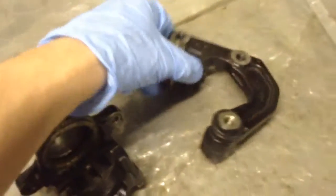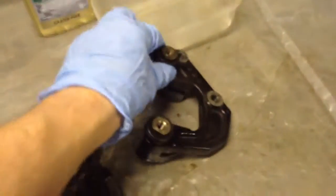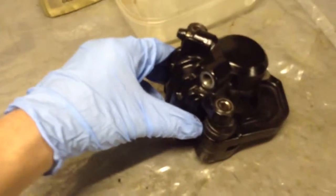The reason I've only taken the right-side one off is because you can then use the hydraulic pressure by pumping the lever to drive the piston out of the caliper. This is the bit that bolts to the forks via that bolt hole and that bolt hole there, and then the other part of the caliper just bolts to that.